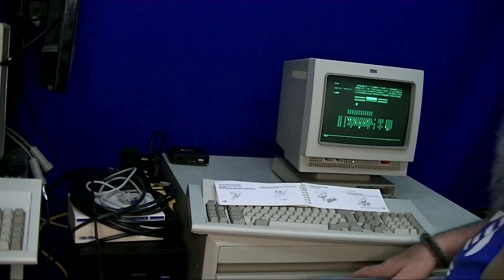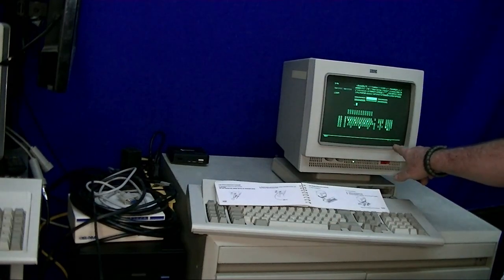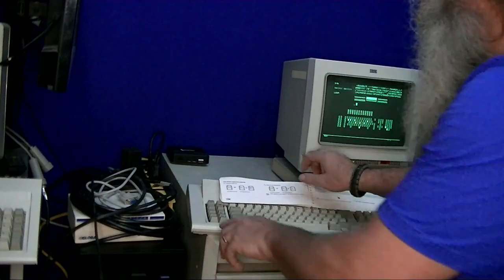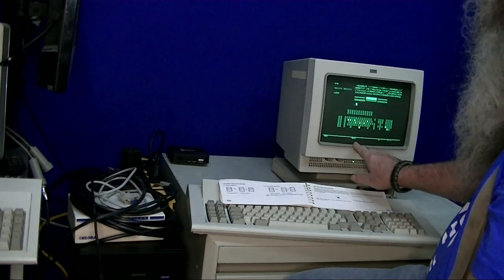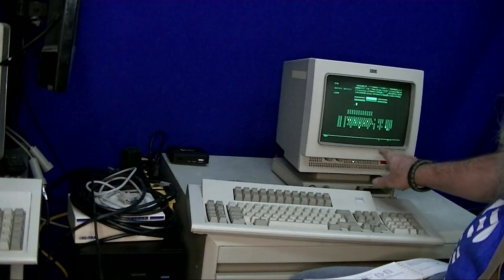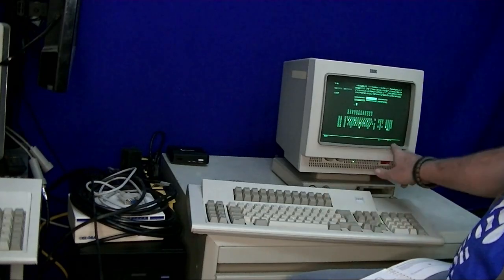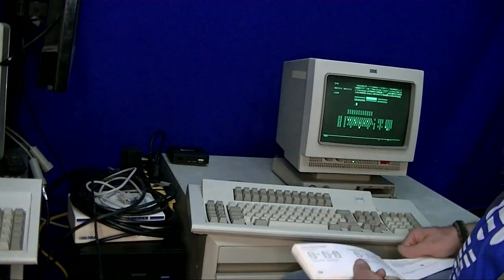Wow. So read the manual. It has a little test down here in the lower left-hand corner. It's got 1 dash dash. So maybe if we go through the sequence correctly until the test pattern appears, okay, press the setup key, system request, and we got that 9012 indication again, but oh, there we go. 1, 2, 3, 4, 5, 6, and 0. So there are 7 possible addresses, 0 through 6, for that line, that port that we're on for the terminal.